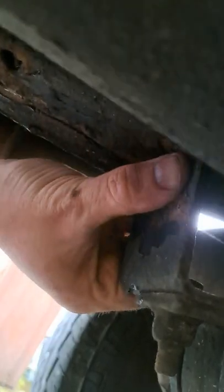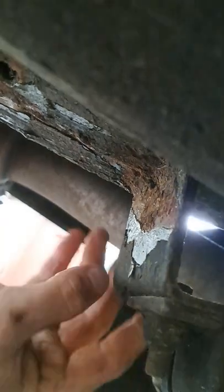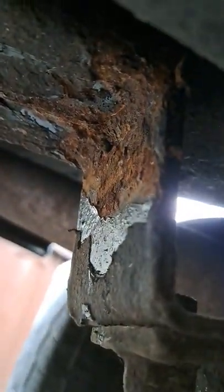If you're going to coat your chassis, rub it down, paint it with red lead and then a wee bit of black chassis paint. In my opinion, that's probably the best thing to do, because otherwise you end up like that.